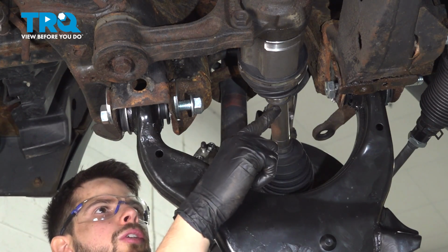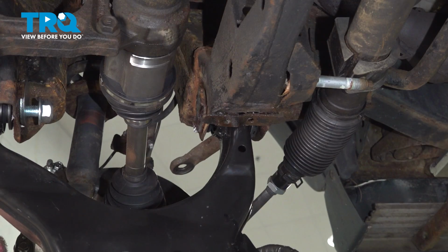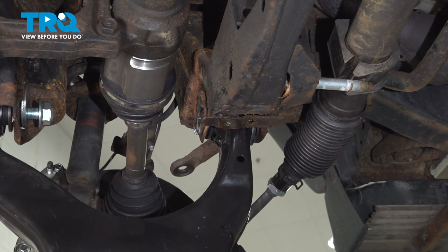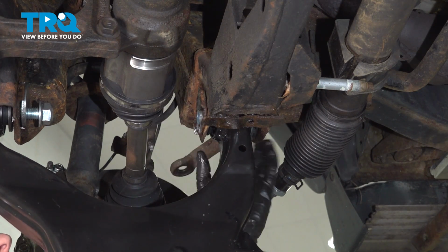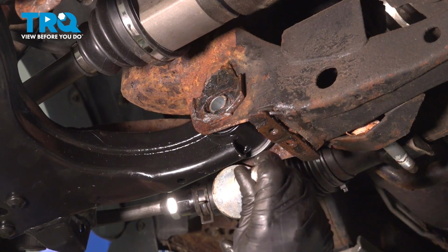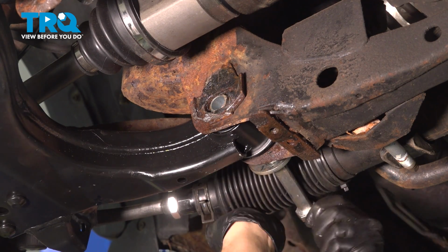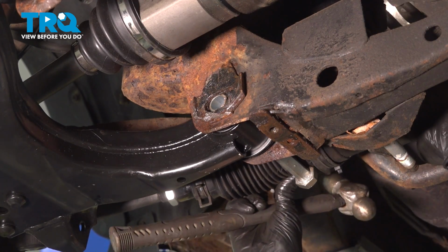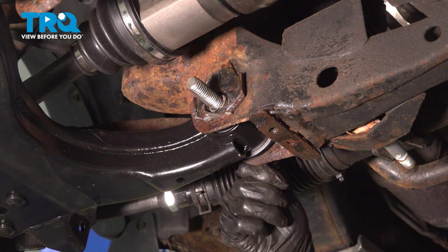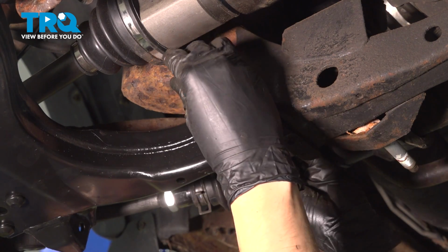Having said that, let's move to the rear bolt. So I'll pull this bolt back out. This one was in here just to hold the control arm. Add some grease. Slide the sleeve in, make sure it's centered. The bolt, I grease it up. I put this adjustment washer on it, slide it through all the way. Put this on the other side, as well as the mounting nut.